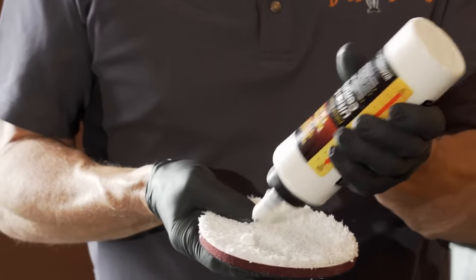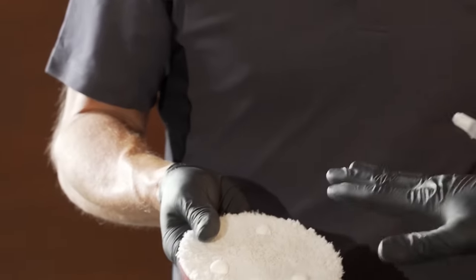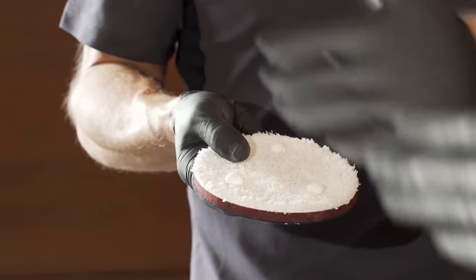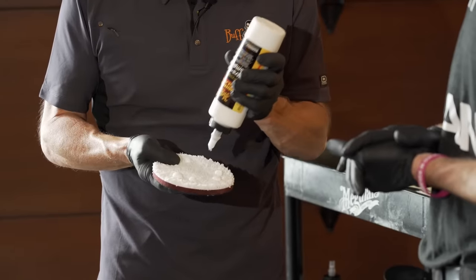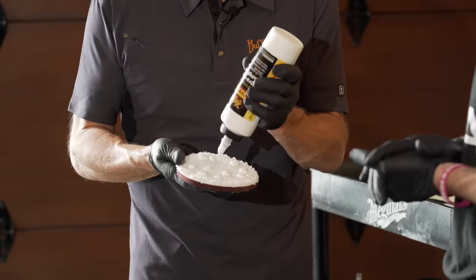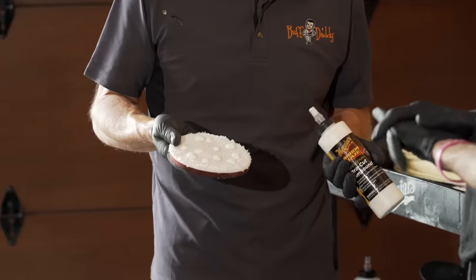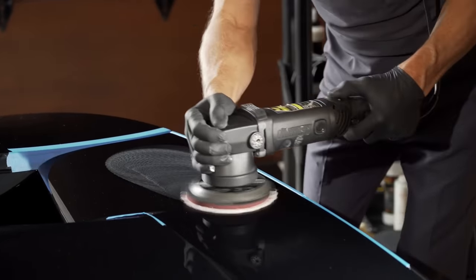As a point of reference, a typical amount of buffing liquid used on the pad after it's primed is roughly 3 pea-sized drops. However, in this scenario, our normal routine is not working, so Kevin increases the amount to roughly 9 to 10 pea-sized drops on a primed pad, far more liquid than normal. This is in preparation for our next step, referred to as a mow-down compounding cycle.